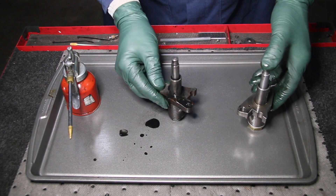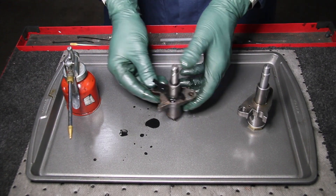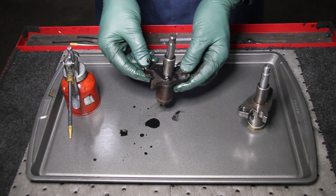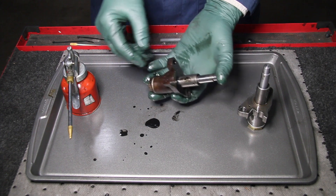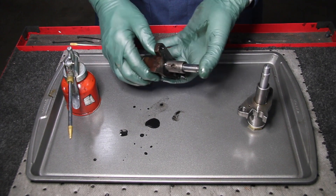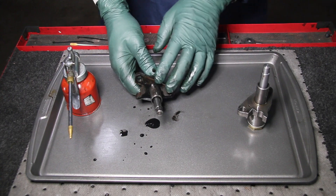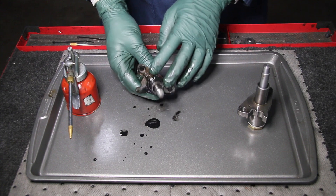Take a look at the bad one — you've got oil squirting out all over the place. I want to warn you about these old style tensioners: they can cause problems and they don't last forever. You should expect a lifespan out of these tensioners around 200,000 to 220,000 miles. From my experience, don't let your engine run up to 400,000 or 500,000 miles and believe these old stories that Mercedes diesels will go forever without some maintenance. The tensioner is something you have to pay attention to. I do sell new tensioners and timing chain replacement kits on my website if you suspect this might be a problem with your diesel engine.